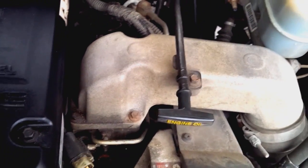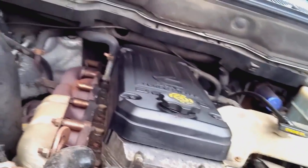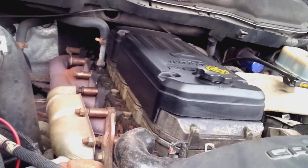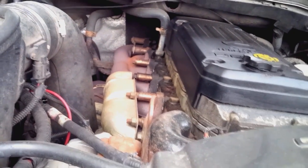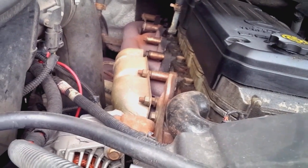There are a few differences in the various third gens between 5.9s, and then of course there's the 6.7. So one thing to note is this is an 03, and also early 04s had a different injector spray pattern or spray events. They only have 2 injection events, whereas the 04.5 and up through 07 have 3. And most people say that injectors seem to last longer with just 2 spray events. Kind of makes sense. So that's on 04.5 up, you'll have the 3. On 03 and early 04, you'll have 2.